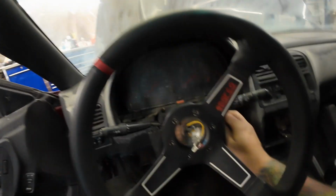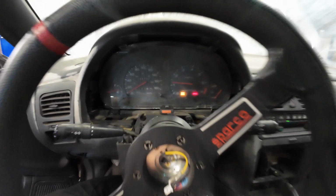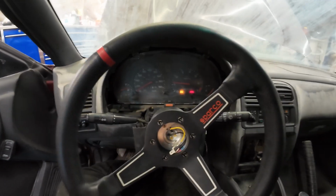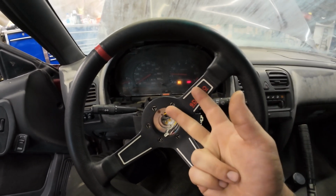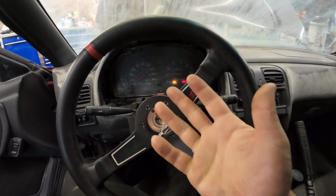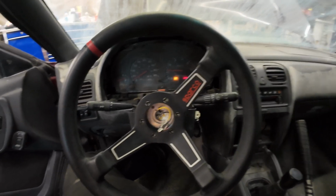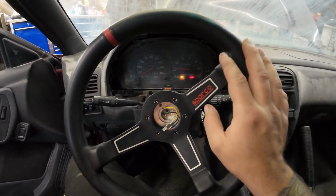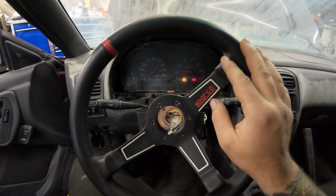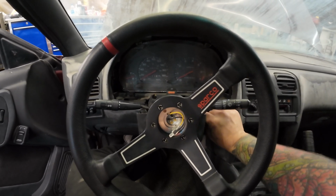All right, let's finish off this oil change. Quick start up. My engine light's on. Neil's coming by today to clear off some codes. One's for the rear O2, one's for fuel tank pressure and temperature things that this car doesn't have, which was never hooked up because they don't have those sensors in this vehicle, but it was in the WX. He said he was pretty sure he turned off those codes, but you know, I don't know, we'll see what's up. Maybe it's a glitch or something like that. Maybe something happened. That's good enough.